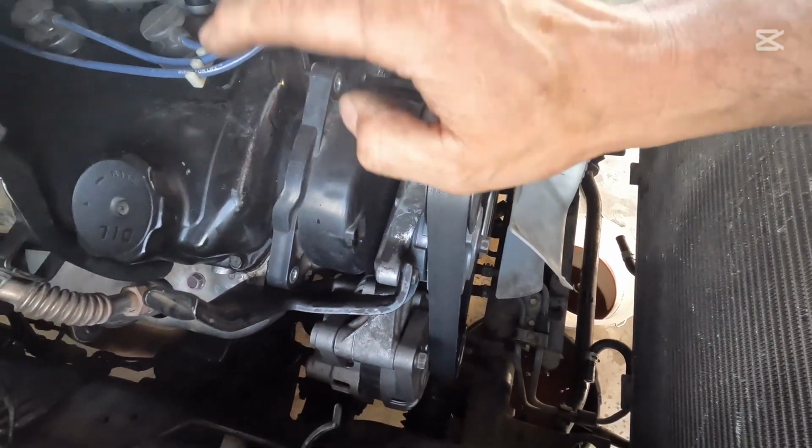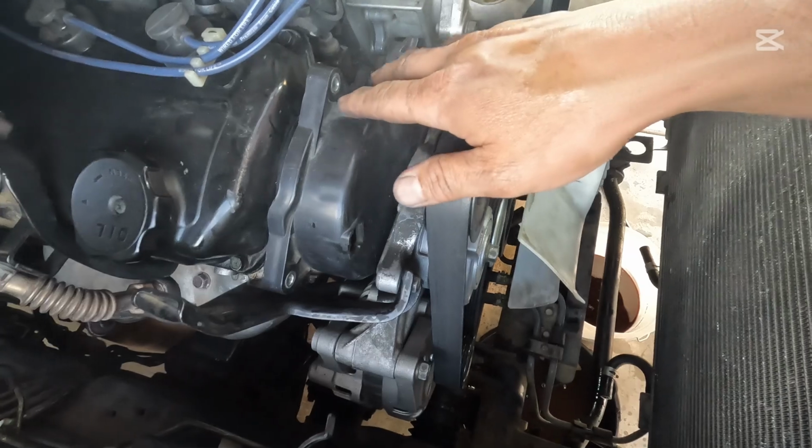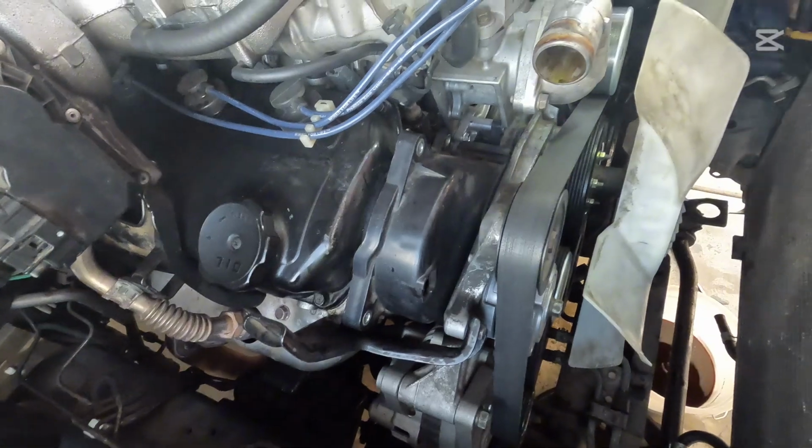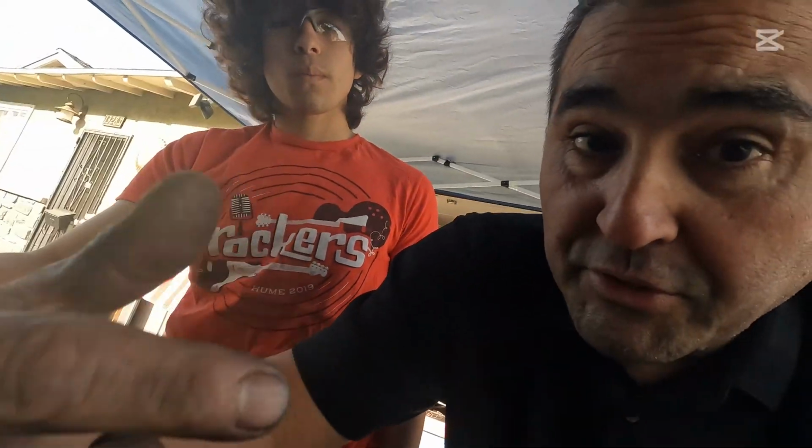A lot of times you want to see if you have little tiny cracks on the rubber, that indicates that this belt needs to be replaced. This one is okay. I know that it's only maybe like 10 or 20,000 miles old. However, the guy that installed it, as I mentioned earlier, didn't do it correctly, and he had the camshaft on the passenger side 1 tooth off, and that was causing a P0300 and some drivability issues. However, it ran okay on the highway. I drove it all the way back from Sacramento, and it drove perfect. So there you go, guys.